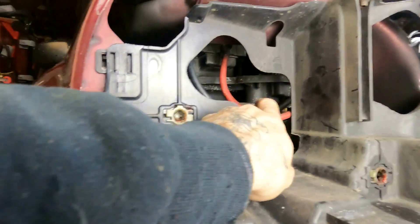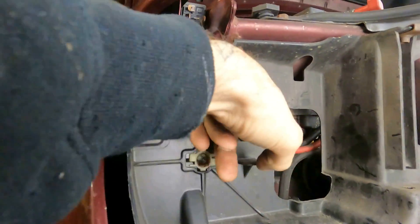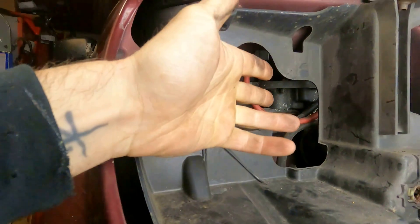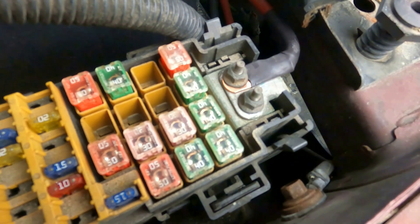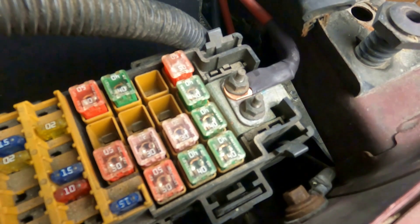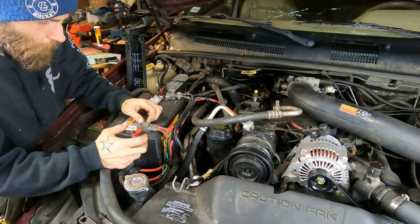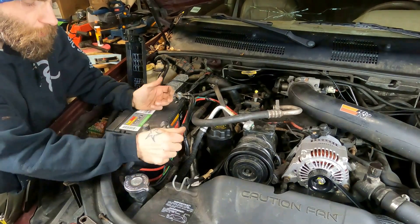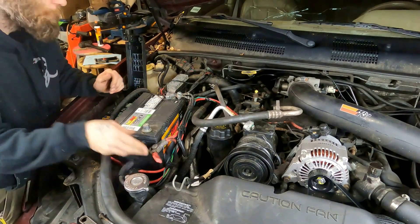You can see my header panel's all beat to heck. This red wire hanging down right here is the supply line to my power distribution block. Before that fateful day, right here is where you would have found that green fusible link. I had no way to get home other than to cut that wire back — you can see I kind of put a battery lug on it, did my best to heat shrink it, and put it over there. But that's really not the right way to do it, so let's take all that stuff out and do this the right way.